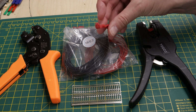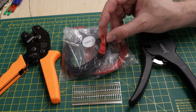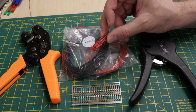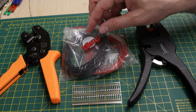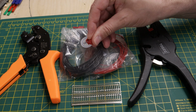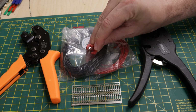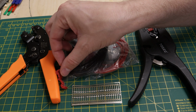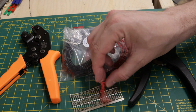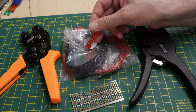I also use many different types of devices to connect up, but my main one for connecting to my bus are these little things just here. These are nice and simple. You wrap them around the wire, you pinch them together, and you use a big pair of pliers, and that just there then basically cuts the outer sheath, and makes the connection.